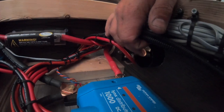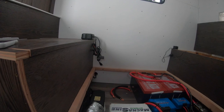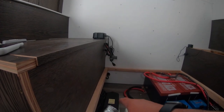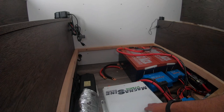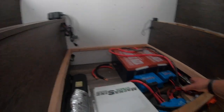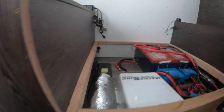Another thing I did to make this work even better: over here I added a duct. This duct allows fresh air in over here. When the cover is on top of this floor it's going to essentially be sealed — not a lot of airflow. So that vent will give us airflow, and I can actually turn this unit on without heating, just on fan mode, to pull a draft through the whole compartment. If this thing is making a lot of heat on a hot summer day, I can turn the fan mode on and pull cool air through all my electronics, then back into the intake on the backside, and back out through the port.